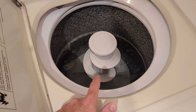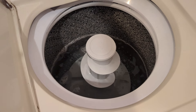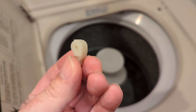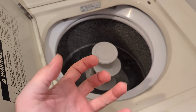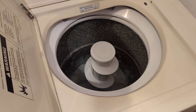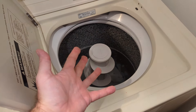The bottom piece is separate from the top. That one is driven off the motor from down below. But this piece here, inside of this cap, has these little pieces called agitator dogs. Over time, you can see they have teeth on them — what happens is either the teeth break off or they wear down. If the agitator binds up, it'll break those. It's a good design because these things are really cheap — I bought like 12 of them for around eight bucks. So they're really not that expensive, but it saves you from having to replace this whole thing or the unit itself.